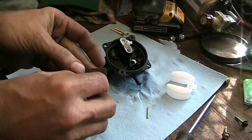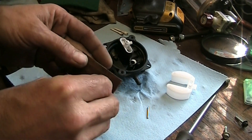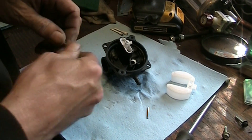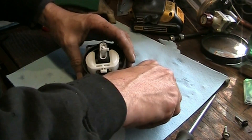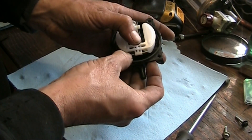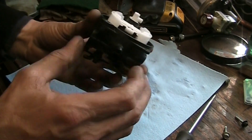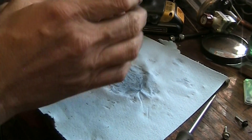I've got a piece of worn-out emery - I'm going to make sure the edges of that needle are clean. It's triangle shaped, so I want to make sure the points of the triangles are clean enough that they're not going to bind up in that opening. Don't want to damage the rubber tip on there though. That looks better than when it came out. We'll get it attached to our float, put our float pin in, snap down on the carburetor - both ends. The float actually moves now! With the float in that position the fuel should be off - I blew through it and got nothing. I tipped it upside down, the float dropped - that should allow fuel in, and it does. Golden.